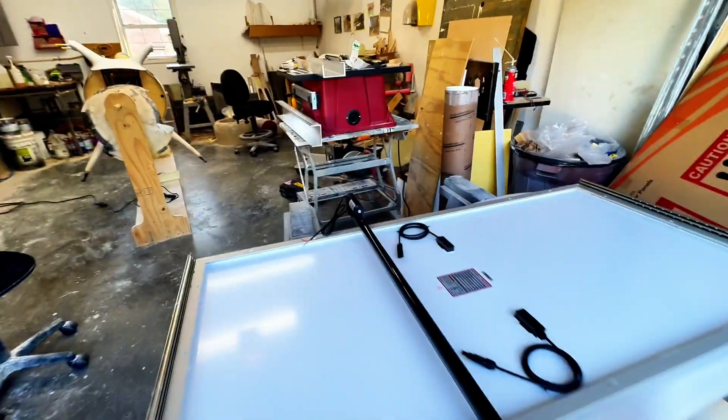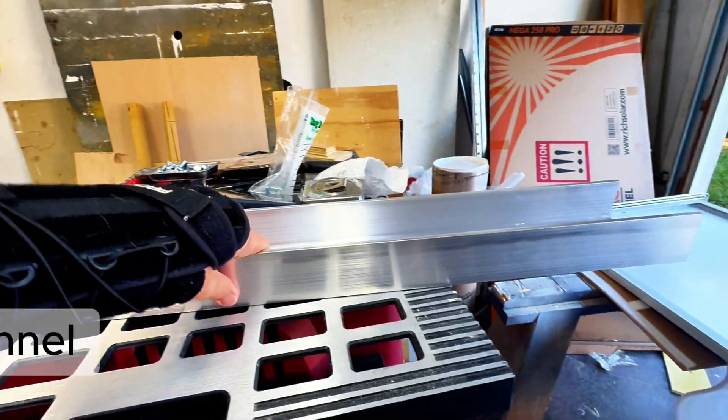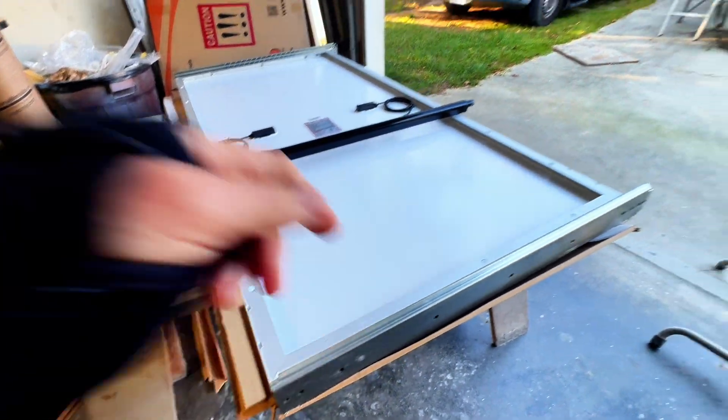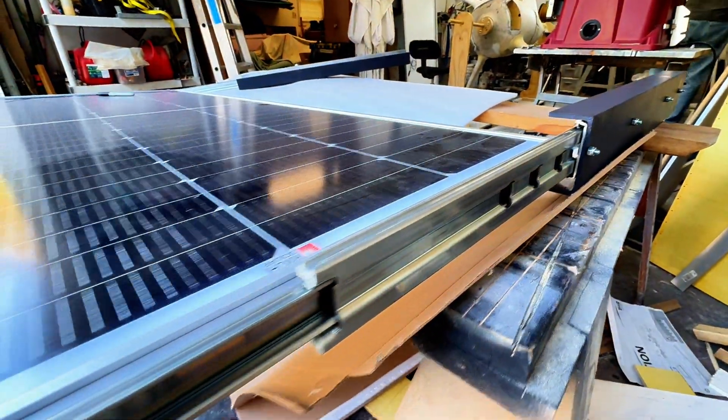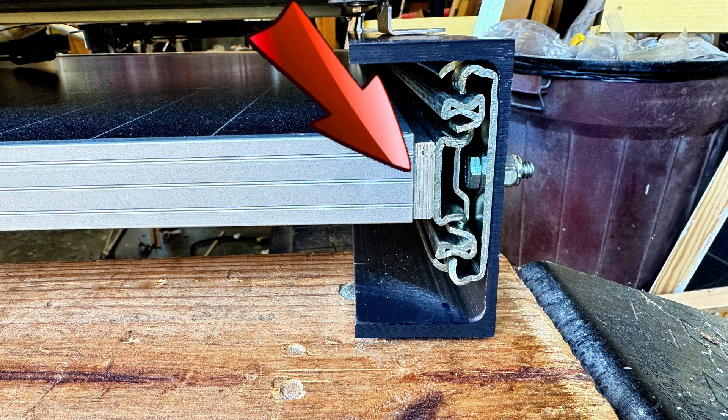The drawer slides are on and will get mounted here. One of the challenges we faced with this solar array upgrade was that during a dry run of putting the solar sandwich stack on top of the van, the holes for the roof rack didn't quite align with the u-channel. So we had to take the whole thing off. Dad's solution was to buy three 36-inch, eighth-inch wide metal bars and mount them directly to the solar panel, then the drawer slides — and then the u-channel. It was a great solution that gave us exactly what we needed, and now we can finally put the solar panel up on the roof rack.